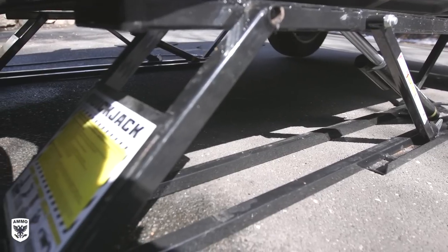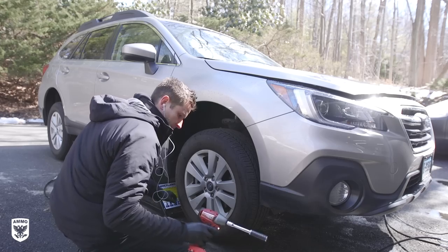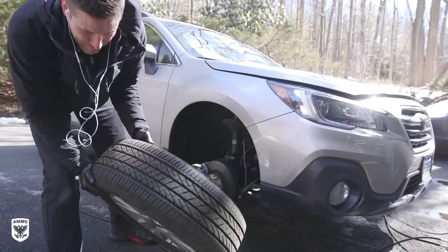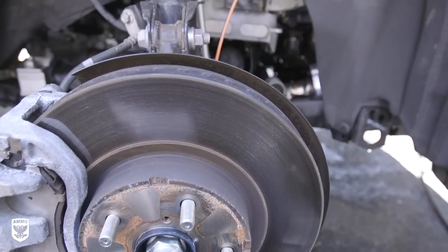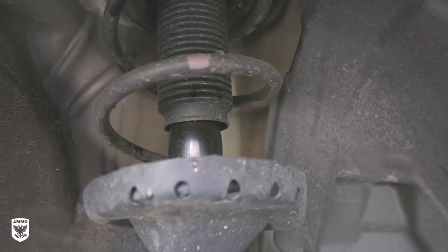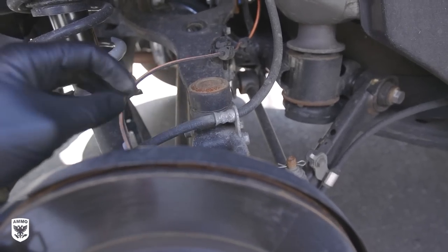Next, I set up my quick jacks in the driveway and lifted the car to remove the wheels. I like to keep the wheels near the respective side I just removed them from because I'm going to rotate them once they're clean. Don't just pile them up on the side and forget which wheels go where, especially if you have the same size tires — it can be confusing. With all the wheels off, inspect the brakes, shocks, and rubber lines for leaks or cracks. I don't pretend to be a master mechanic, but I can at least know if something looks weird or leaky and then discuss it with my mechanic ASAP.